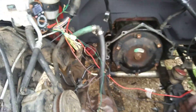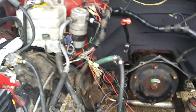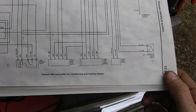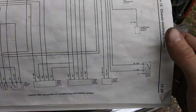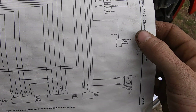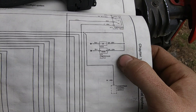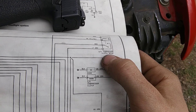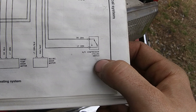This video is really going to be for someone who has accidentally lost the wires and needs to find them, but if you know where they're at that's even better — it'll make it a lot easier. Best piece of advice I can give you is to find the schematic for your electrical wiring. This would be typical '94 or earlier air conditioning and heating system, and the part I'm focusing on is the AC compressor clutch and the wiring coming out of it. You've got the AC compressor clutch relay — that's the one I heard click when I pushed the AC button — and you've got an AC compressor cycling switch.